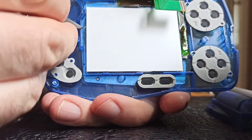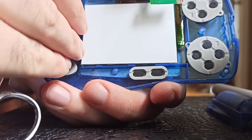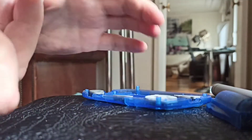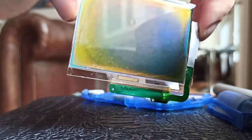Just before doing so, you need to remove this ribbon cable. Then with a sharp instrument you need to pry off the screen assembly. Here you can see the burn of the screen, which really isn't a burn — it's just the aging of the glue.